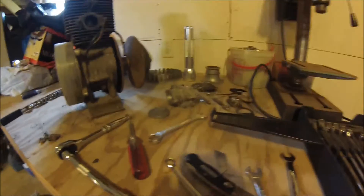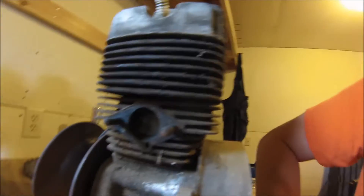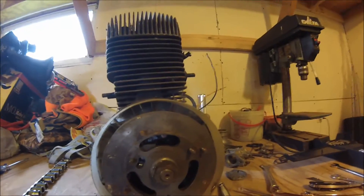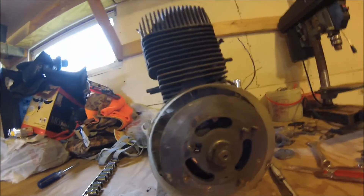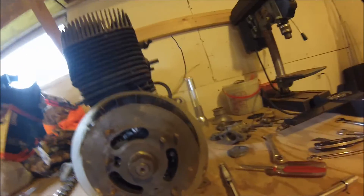Alright so we've gotten a little ways into it here. Looking in the cylinder from the intake side, the piston looks like it's scored. We'll probably go the rest of the way just to make sure things are alright, as long as I can get gaskets to put it back together. It's got a points and condenser system for ignition and I'd like to get to that and make sure it's all working good on the inside.